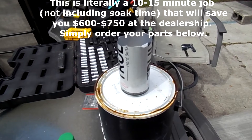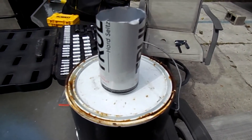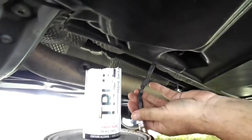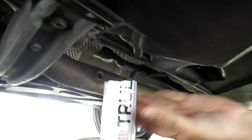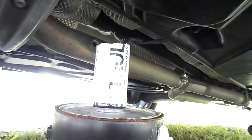Taking off all that other stuff would probably take me three times longer. So I'll just loosen it, position a paint can so the head of the sensor is down in the liquid. Back underneath the GLK 250, I've slid the gallon bucket under there. The half soda can is filled with Lucas. We carefully set the sensor down into the fluid — we don't want the wires in it, just the sensor itself, so the fuel cleaner can clean all the carbon that's in it.